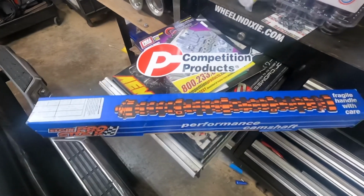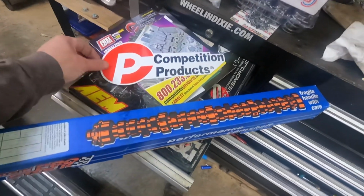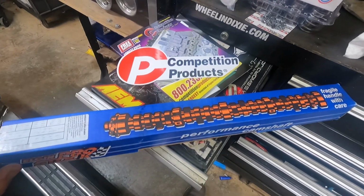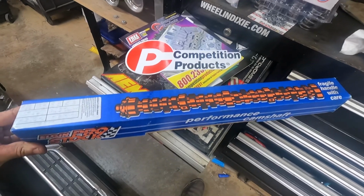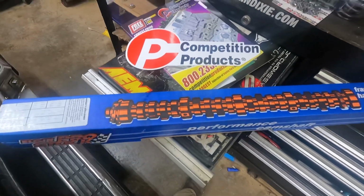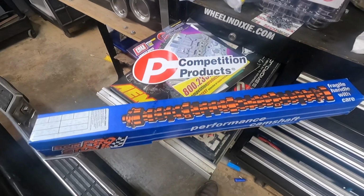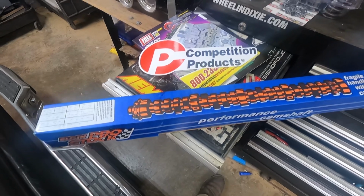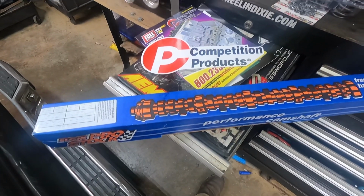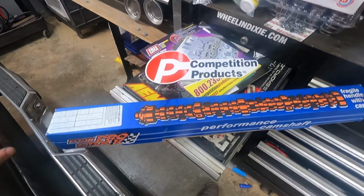Alright, I'm ready to slide the cam in, start getting this thing buttoned up. I know a guy that works at Comp Products. I'll leave his number and extension in the description of the video. I went through Comp to get this cam kit. It's an Elgin hydraulic flat tappet, a 527, 553 lift, and it's 224, 234 at 50. Never ran one of these cams, no idea what it sounds like. I'm not really expecting much out of this stock 454 because it's just low compression, nothing done to it, but it seems to be pretty solid, pretty fresh. But that's the cam we're going with.